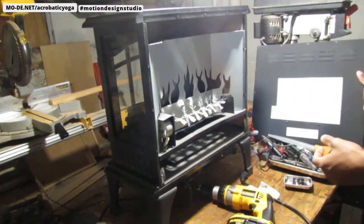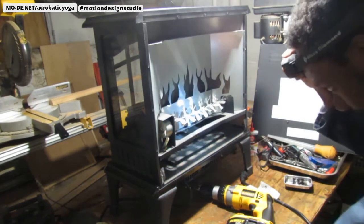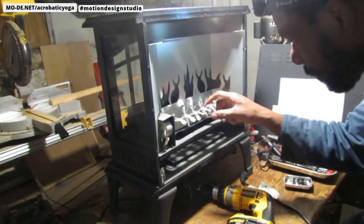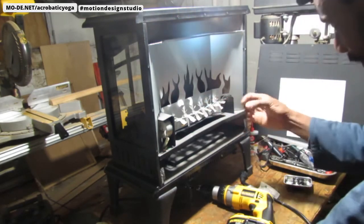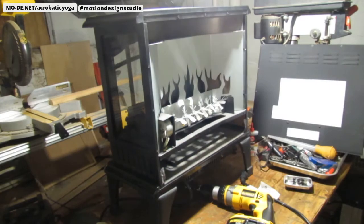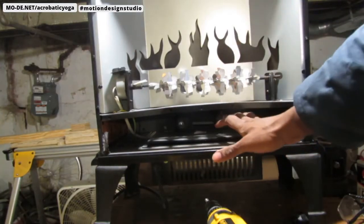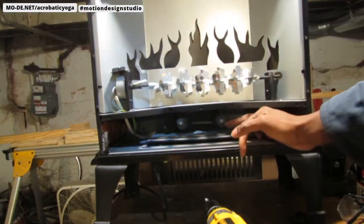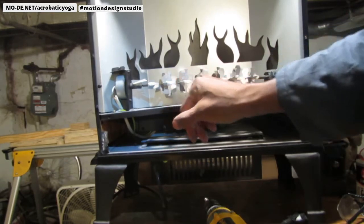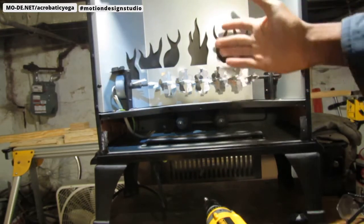Alright, that is the back of that. Those are two bulbs right there. This probably creates that flickering effect with the lights. So right here we have all the little lights coming off of the bulbs - plural - right here. These are both 40-watt bulbs. They reflect off of these reflective little fins into this cut-out shape of a fire, and that's what gives the effect.